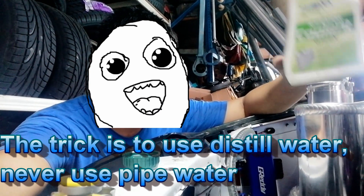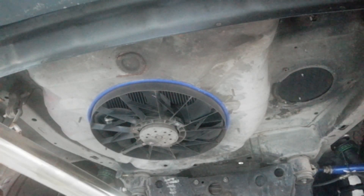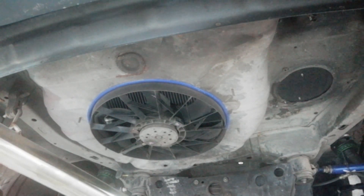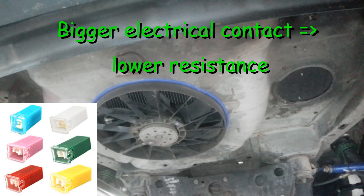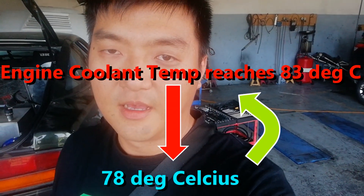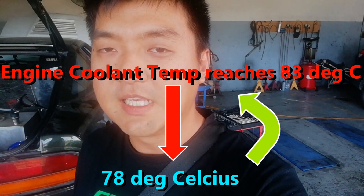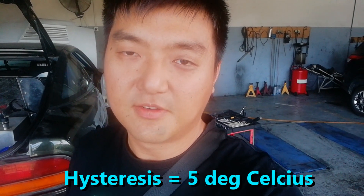At the bottom I'm using a Mercedes-Benz electric fan — this one is super big and draws a lot of current, so I'm using a big Mercedes-Benz fuse and a relay for it. I'm using the ECU to control this fan, so when the engine coolant temperature sensor reaches 83 degrees Celsius it will turn on, and when it cools down to 78 degrees Celsius it will turn off. The hysteresis is 5 degrees Celsius.